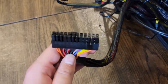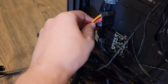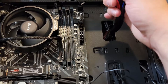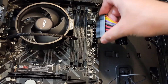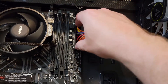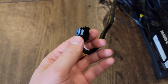Next we get to our 24-pin connector. Make sure to have this plugged in because this is what powers your motherboard. Run this cable through one of your side grommets — I'll use the top one. You'll notice two different sides: one big pin on one side. Make sure that big pin is pointed towards the back side of the board, away from you. Plug it on in — it'll just slip on and you apply pressure. Your 24-pin is going to power your board.